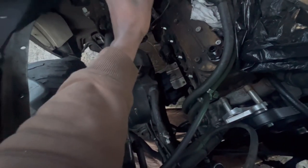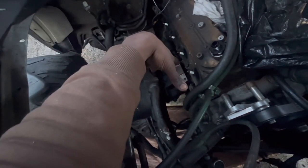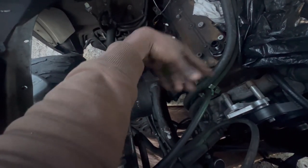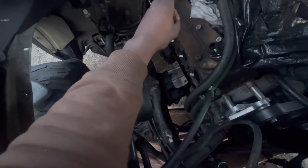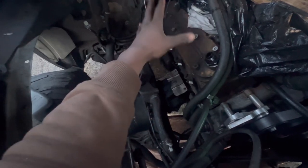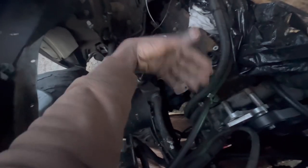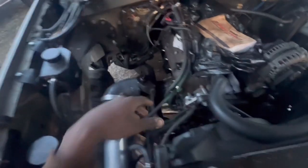What we need to do is get this side off. I need to remove these spark plugs, these bolts, get this off, throw in a new head, torque the bolts, and all that. Then put the rocker arms in — I'm gonna do it a trick way I seen where you can tighten them all one time. You don't have to go back and forth doing each one; you can do all of them at once.